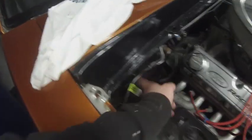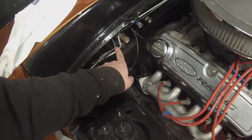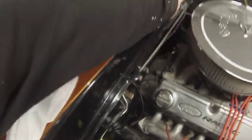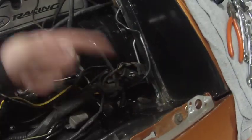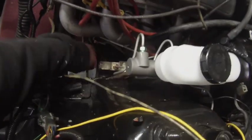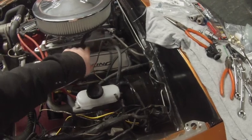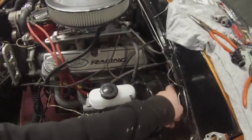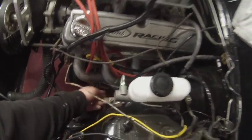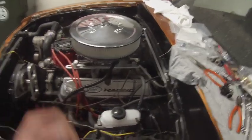As for the passenger side, if you buy this kit, your shipping bend will be roughly here. I have them both running with the rear one — the one that's painted black — and then the new one running along with the rear brake line all the way across to the booster. Then these ones tuck down underneath, run under the booster, and then they will come up from the proportioning valve over here. So on this side I have one, two, and three. Now we need to cut-flare this one. I believe this one goes a different route, but because of the length and what I have, I'm just doing it this way to match the other one behind the booster and up and under. I believe the passenger side one goes to the rear of the prop valve, and the driver's side goes to the front of the prop valve underneath. So we're going to get that installed and then we'll work on our soft lines.